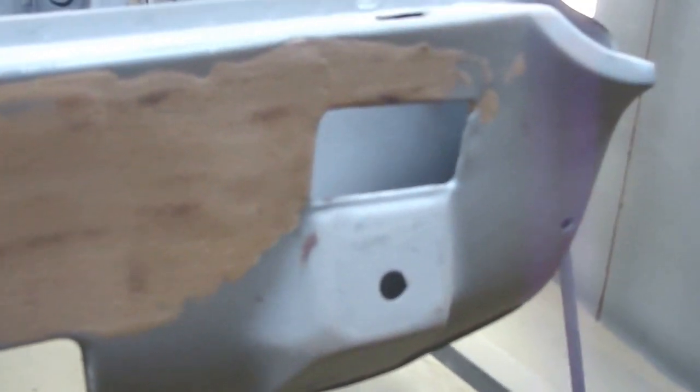We actually strip in layers, and so all the paint and the primer have been taken off the front of this. Now my wife does all the blasting here. She's down to the Bondo, and she'll come across here, and it's probably going to take at least another 2 passes to get all that Bondo off. If I could put the camera at a certain angle, you can see how the Bondo is built up on the front of this. There's more than 1/8 of an inch of Bondo on the front of this. So it'll be interesting to see what that Bondo is hiding.